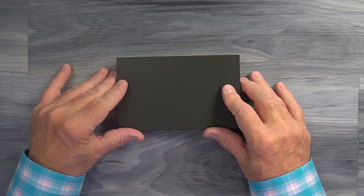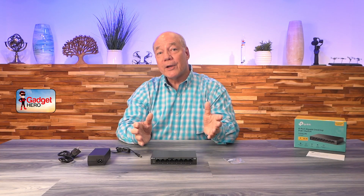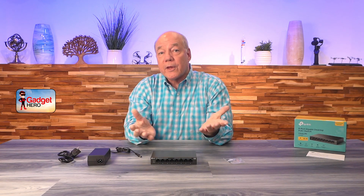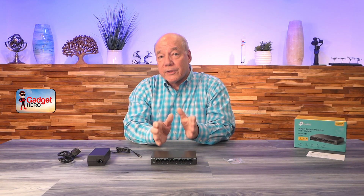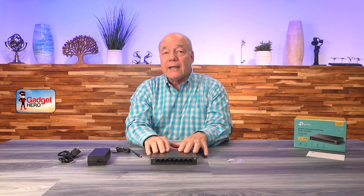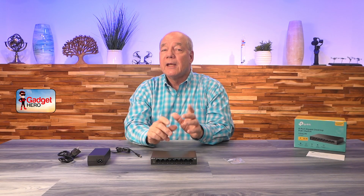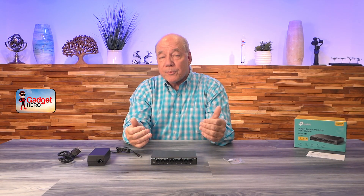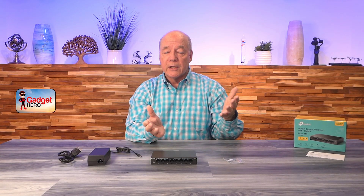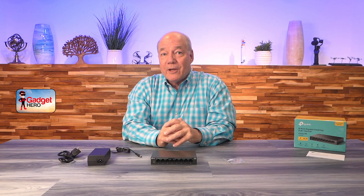It's a really nice unit — plug and play and easy to use. Here are a few important things to keep in mind when comparing this TP-Link PoE switch with other products. The first is the number of ports: this switch provides 8 1GbE PoE ports, and all 8 can provide power externally to peripherals. Other PoE switches with 8 ports may only provide power for 4 of those ports, meaning you can't use all 8 for peripherals that require PoE functionality.